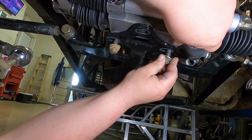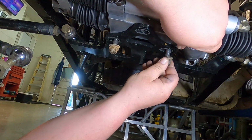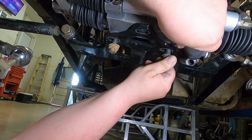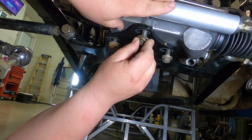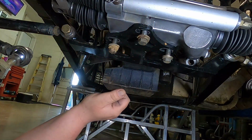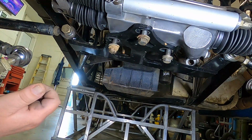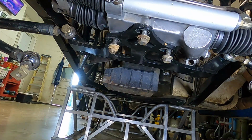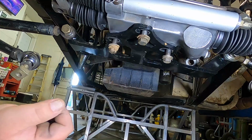All right, we're gonna get these 3 bolts put in right here. We're gonna get the steering arm put on. We'll get the tie rods put up in here. We'll decide how far around. We've got the slotted rack mount here, so we'll decide where we're gonna push it, left or right, and see what's most advantageous for us. And then at that point, we'll be ready to put it down and set the toe once we get the hydraulic lines hooked up. I'm gonna slap you guys over to some time lapse here. We're gonna finish it up.